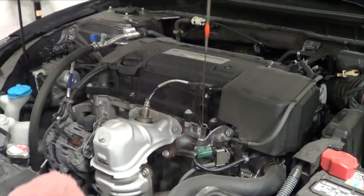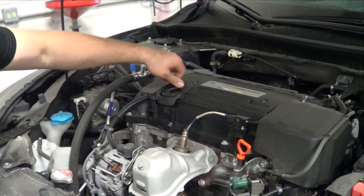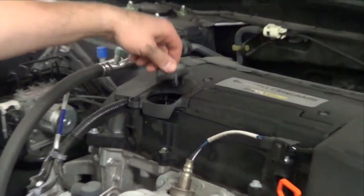For most of us that don't have a shop, we'll want to spread either a plastic sheet or maybe get a piece of cardboard on the ground so we don't get oil everywhere and make the wife unhappy. Hey, it's always a good idea to check the level of oil before you get started. To get the oil flowing without lugging, I would recommend removing the oil fill cap before you start. Next, we want to jack up the car and utilize some jack stands and put something behind the rear wheels so that the car doesn't slide.